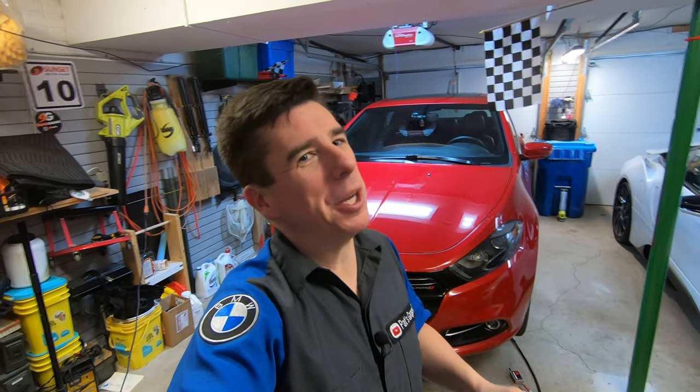So this thing came with earbuds. So I put the earbuds in and I could hear the ticking of the bearing much better than I could with just the speaker. So at that point I knew it was the left front, and I also steered the car towards the left, which causes weight to be taken off the left and the noise went away. So I could also tell at that point that it definitely was the left wheel. If I turned towards the right, then I got more noise in the left, and I could hear that in the earbuds, but I couldn't hear it well in the speaker.